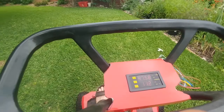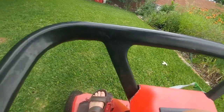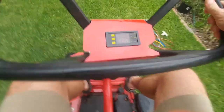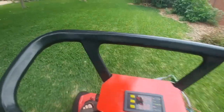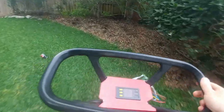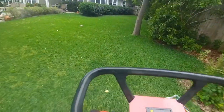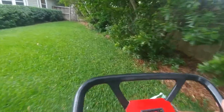I'm going to come to a stop. My grass is really not very long but I'm excited to make this video, so I'm going to mow in second gear. Putting the blade on now — it's going to be much louder with the blade on. Still nothing compared to how it was. I'm pulling about 30 amps roughly. You can actually hear me over the sound of the mower — the blades are by far the louder part of this operation. You can hear stuff you run over; you can hear sticks and grass actually being cut, and swinging the blades makes quite a bit of noise.